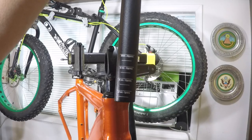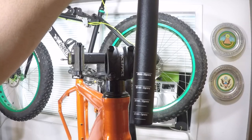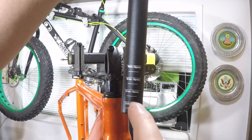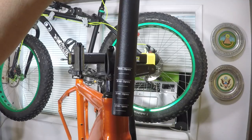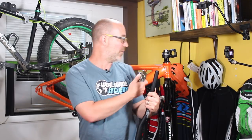Your handlebars will have lengths marked — like 12 millimeters, 24 millimeters, 36, 48 millimeters — so they'll give you the length that you're cutting off. Some of them just have lines, but you want to use these as guidelines for how wide you want to cut your handlebars down. The best way to decide if you should cut your handlebars is by putting them on full length, going for a ride, and giving that a try. You shouldn't just be hacking away at your handlebars without even knowing if it's going to work for you.